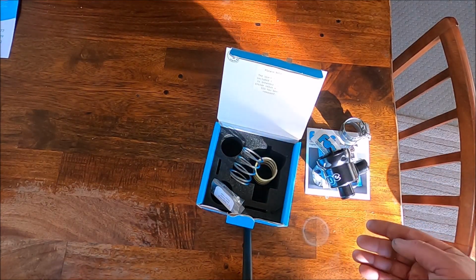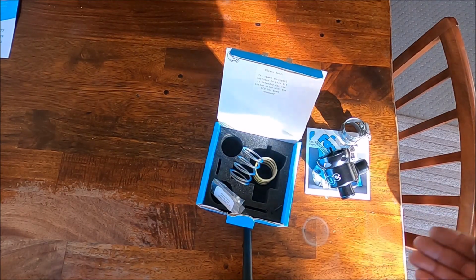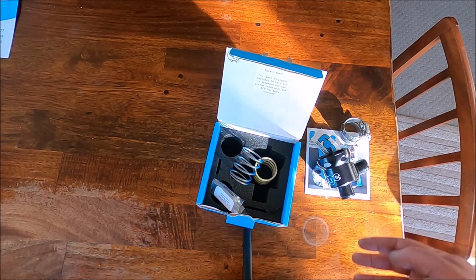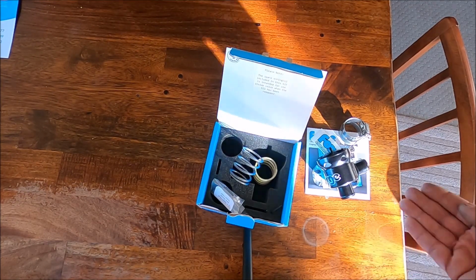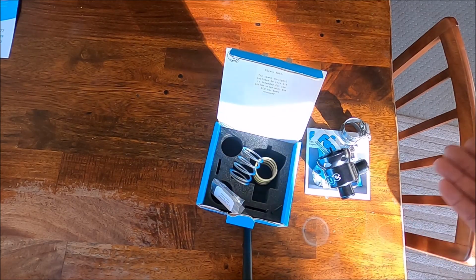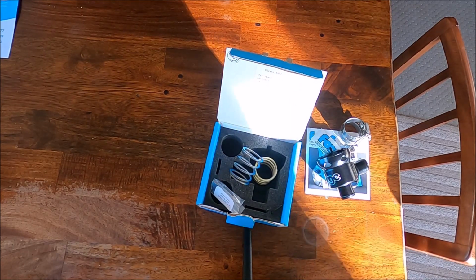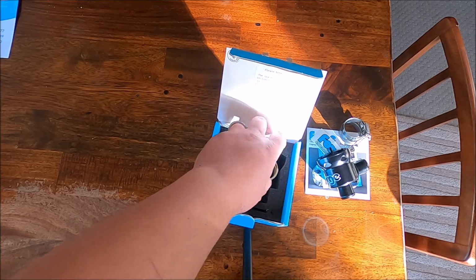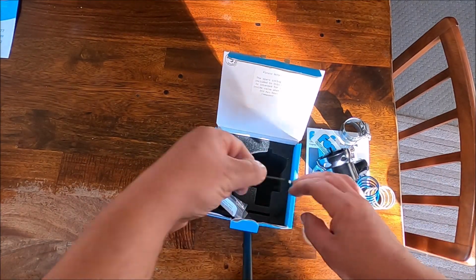And in my case, I need this bloody thing to open because my MAF sensor goes crazy for some reason if there's no dump valve or no diverter valve fitted. Some cars with a MAF, most in my opinion and experience, don't care. But this Volvo does not like not having a diverter valve. So I can't have a too stiff spring, otherwise you may as well not have one. So this is ideal for that.